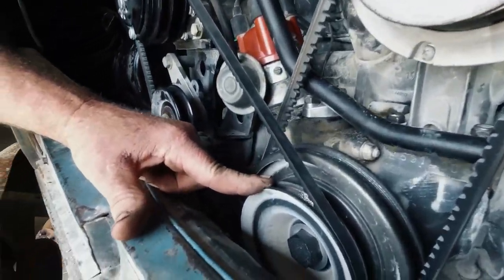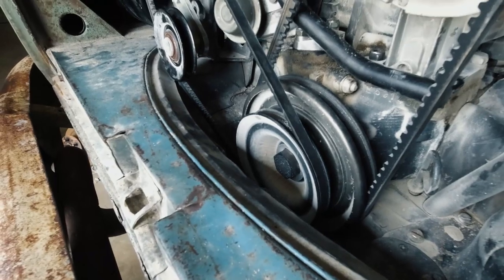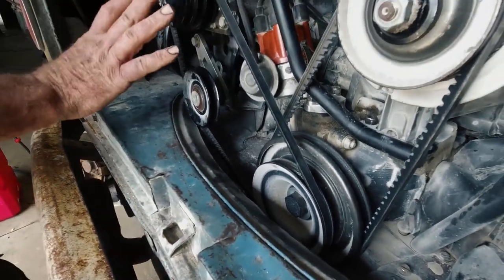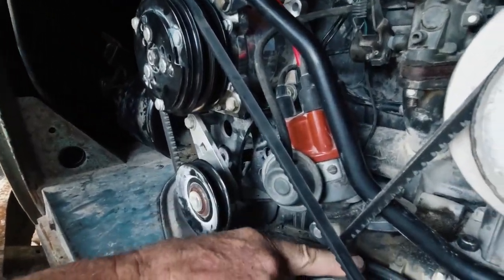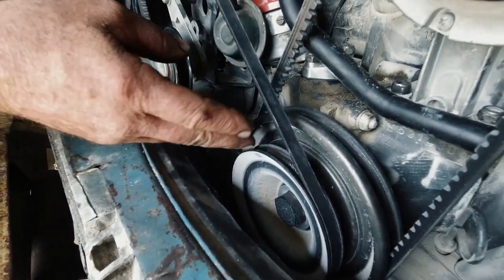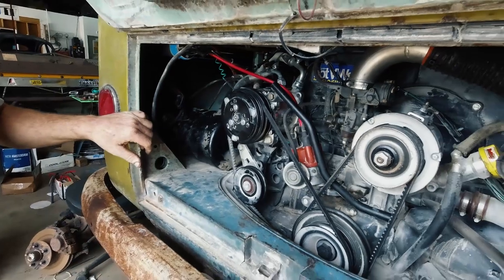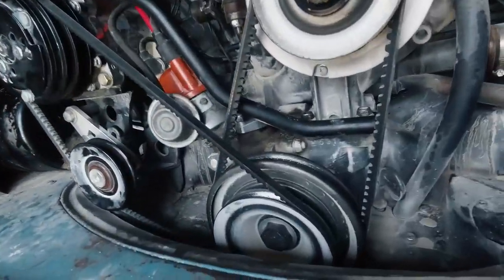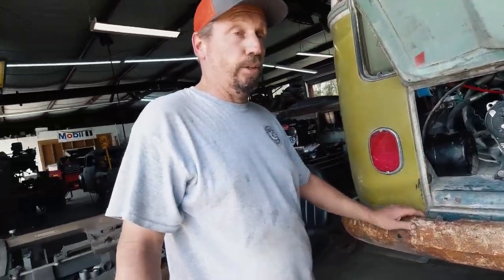Now it's got a compressor mounted. I did use the smaller — this is a factory AC pulley a friend gave me — it's much smaller than the crank. On some of the older Beetles they use them because it keeps the compressor pushed back a little further, but the difference in gearing between that and the crank is huge. It already takes some power away from the engine. With the smaller one, if you put it on there, chances are it's not going to idle — you'd need an idle-up solenoid, and I didn't want to deal with that. I just wanted AC, so this is how I did it. But it blows cold — it'll blow 40 degrees out of it even at idle.